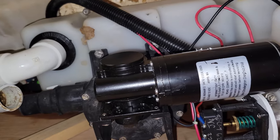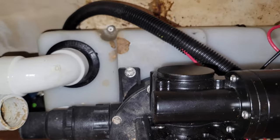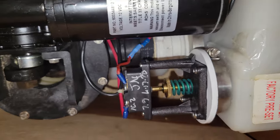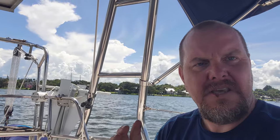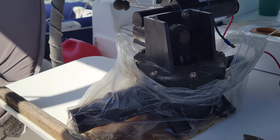Our head in the back room went out. You may remember I replaced the motor on the vacuum pump but it lost all vacuum. To get to this pump it's located right under the bed, down there. To remove it, there are four screws - I only have to take off one side. I have to loosen this fitting back here, take that loose, and hopefully it'll just slide off. Then disconnect the wires - with everything disconnected you're going to get the great smell of raw sewage. It stinks. When you get the pump out, bring it out to a table in a bag so you don't spill anything everywhere.